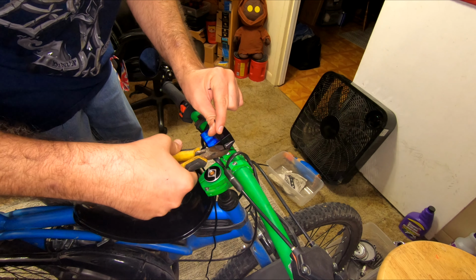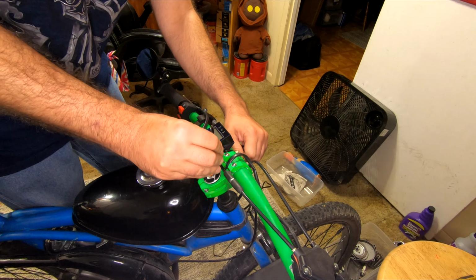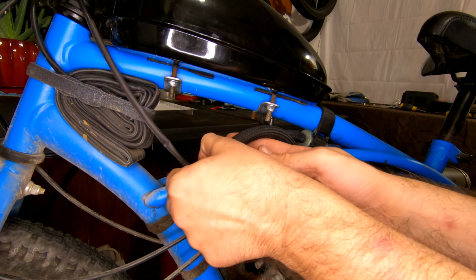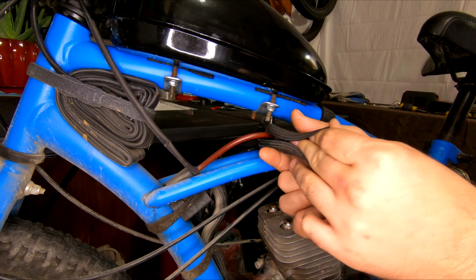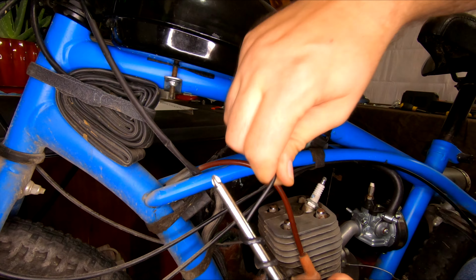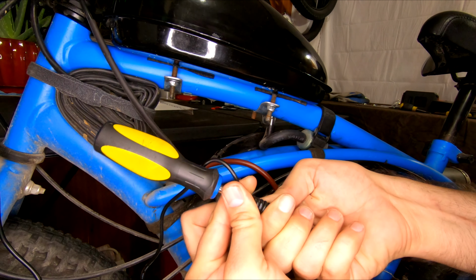Now this has a small screen and a refresh rate of only about a half second, so it's not a tachometer you'd use if you're looking for something kind of showy. This is just for technical purposes. Setting your idle, looking for your peak power RPM range, and your maximum RPM range, which is handy when you plan on doing things like more efficient port work or getting a tuned pipe down the road.